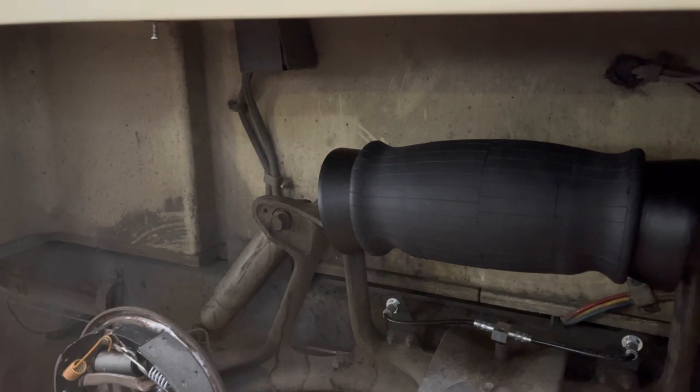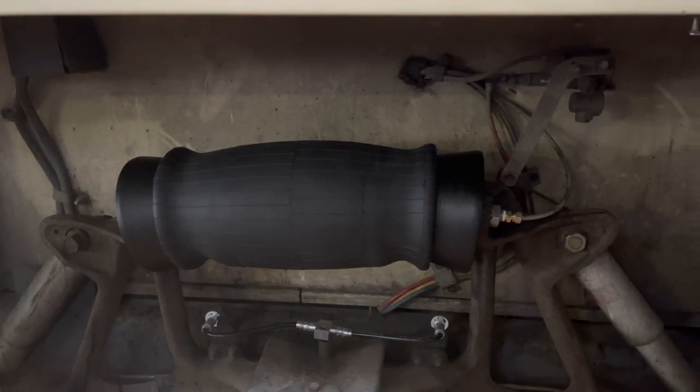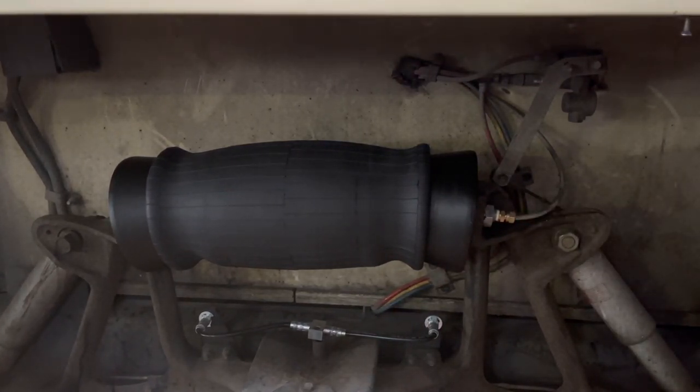So there you have it — one of the coolest parts of the GMC Motorhome is actually one of the easiest to replace. The only thing left to do is to spray this down with soapy water to check for leaks. Use something like Dawn dish soap in a spray bottle and look for air bubbles — the air bubbles are the air passing through, and that is your leak. If you have a leak, just tighten down the fitting; it will most likely go away. These airbags are available from Cinnabar Engineering, and the original airbags made by Firestone have been out of production for years. I recommend keeping your old airbag as a spare just in case of an emergency. Make sure to have fun, use your GMC wisely, and travel safe. Thank you for watching.